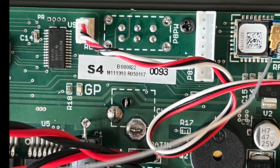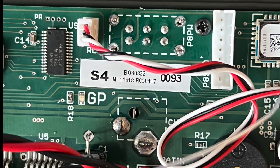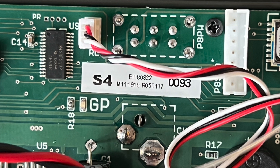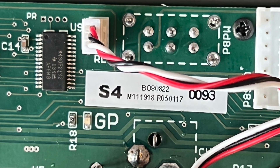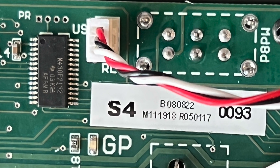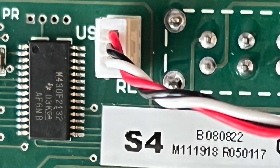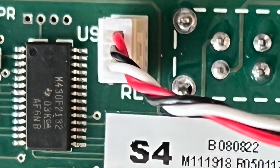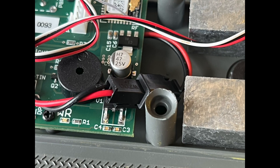Here is the rear light connector. Similarly, it has a black ground, a red wire, and a white wire — one for the cab light and the other for the backup headlight. When I first tested it, the cab light would go on in reverse and off for forward, and the rear headlight would stay on continuously, so I had to flip this connector around backwards as well.